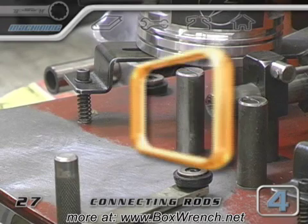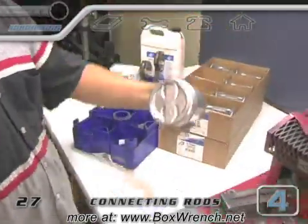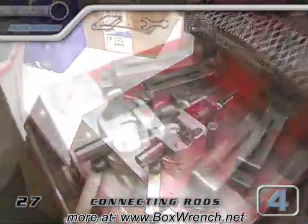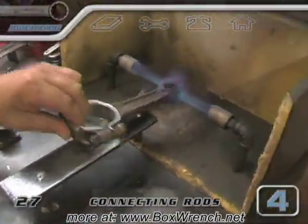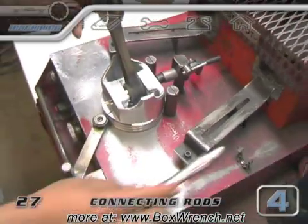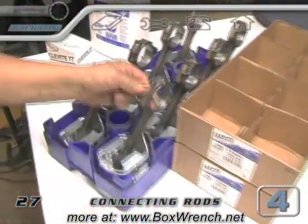This is not a simple procedure. The rod has to be facing the right way on half of the pistons and the other way on the other half. And if the pin isn't passed through quick enough, the rod could cool just a bit and the pin would get pinched too early. And then they'd have to go back and press the pin out and try again.